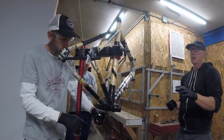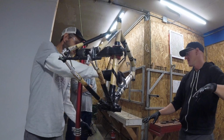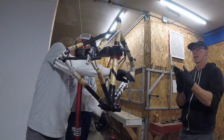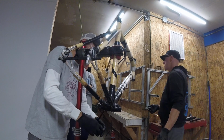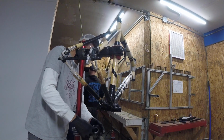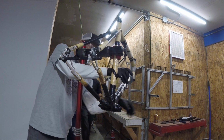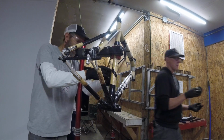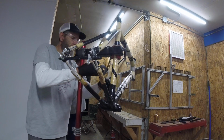Do not cut the end of the tape off when you're done. Pull it out and just let it hang in space. Because if you close the tail up and it gets epoxy over it, you'll never find it. And then you have to razor blade a whole entire roll of tape off of your bike, which I guarantee will bum you out. After lunch, we're literally going to come back and just unravel it. It will take a couple of minutes. So that's the plan. Rusty, I'm going to give you this one.